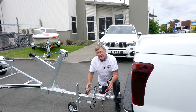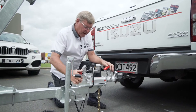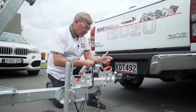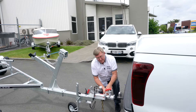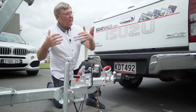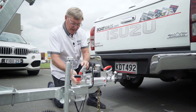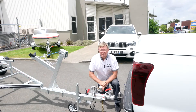750 to 2,000 kgs it's recommended; 2,000 to 2,500 kgs braking is compulsory. The way this one works: when you get to the ramp or the beach, flick that over and it'll stop the brakes going on. When you take that off and want to store it somewhere, flick that over and the brakes are on — it won't move anywhere. It's that simple.